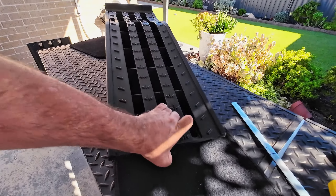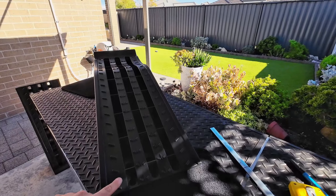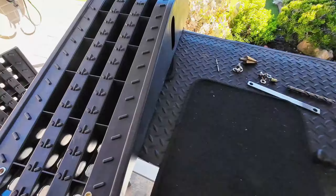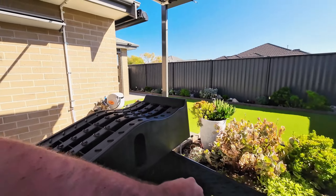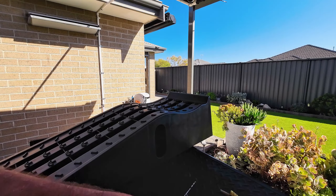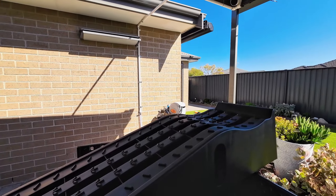So that's going to be my washer essentially. Cut it in half — I only need two of them. Drill a hole. I'm going to use rivet nuts. I reckon that'll be strong enough. It's not going to have a lot of pulling force — the car's going to be doing most of the work. We've done this without even attaching the mat to the ramp and it didn't pull away, so this is just to keep it all together. I'll use rivet nuts and some stainless bolts. I'll put them in these recessed bits so they won't be scratching the floor. So I'll cut that in half — just going to use a hacksaw, it's a quick little job.